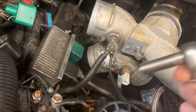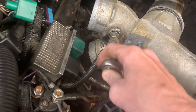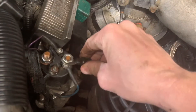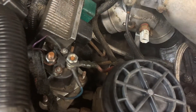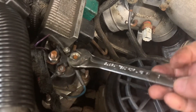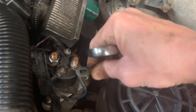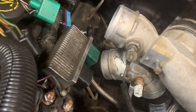Get a 10 millimeter socket and a ratchet. You're gonna want to take this 10 millimeter off — this is your positive wire, and it is attached right here. This is where you're gonna need your 14 millimeter. I got everything ready to make it a faster video. Take that off — usually this little wire will be on top of it. Take your wire and toss it in the trash; you're not gonna need that anymore.